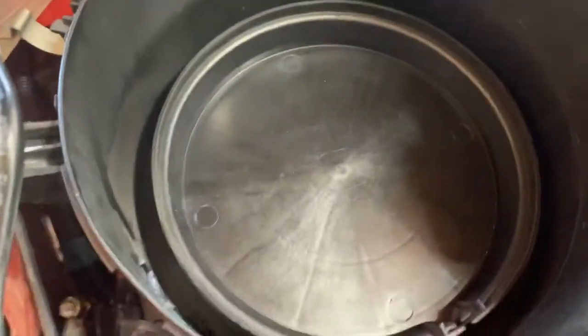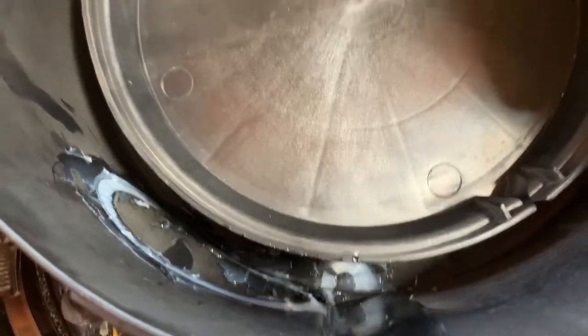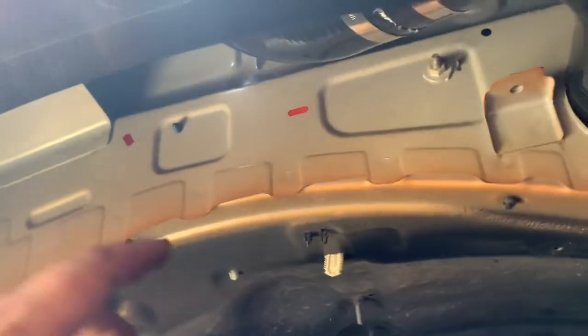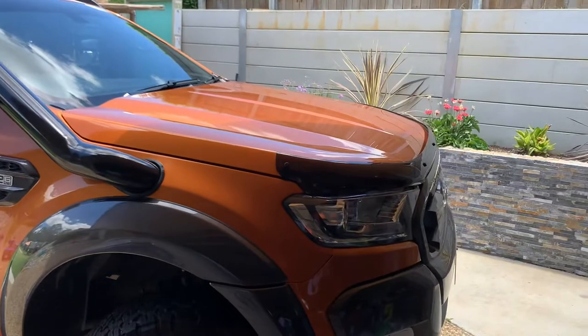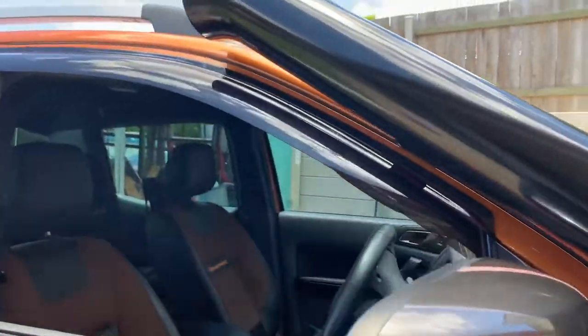Silicon hoses are fitted down there. I've sealed up all the intake there — I just use this little spatula to smooth it around. And this is all the piping they give you for underneath. Just got two clamps there, one up there on the four inch. The only thing I suggest is when you're doing these ones, just make sure that you can feel the stainless inside the silicon before you do the clamps up, because you don't want them popping off. And that's it — that's the finished product. Really nice, very happy with everything. All the inner guards are back in, silicon's all tightened up.